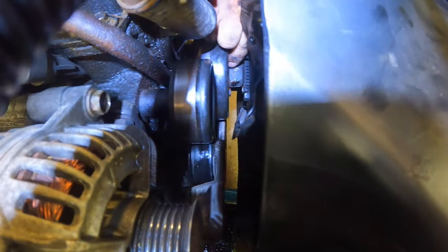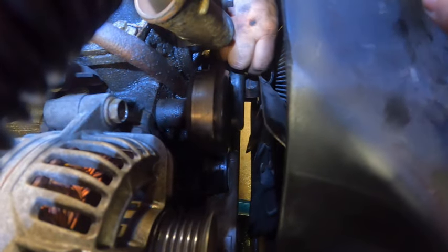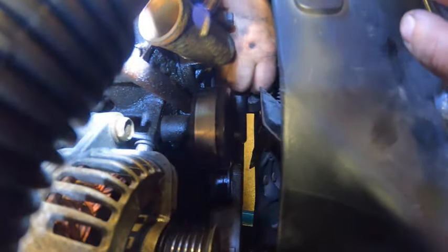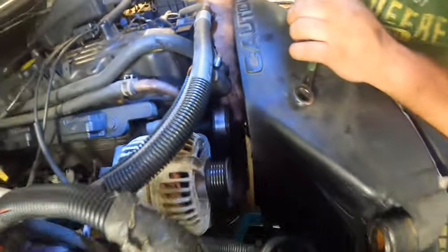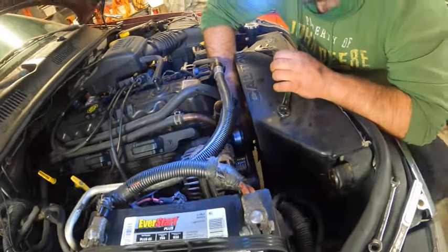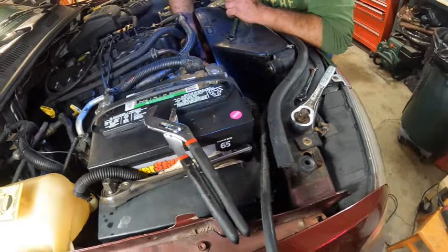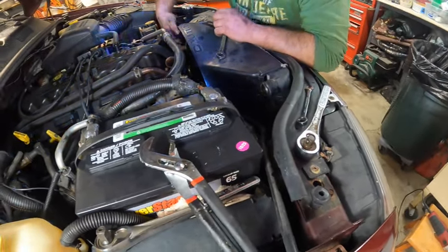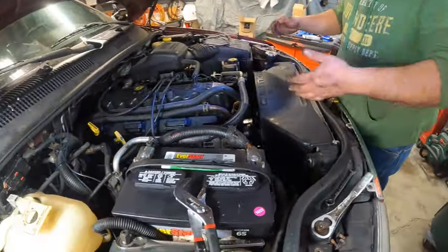We really struggled getting this fan clutch pulley assembly off of this car. And he's removing a small nut that holds the pulley on. Don't do that. We've already removed the belt. Don't do that. We've already loosened the fan shroud. Don't do that either. The first thing you have to do is get that big nut right below his finger, and that will allow that fan to unthread. The way you do that is you take a small needle nose vice grips, clamp it to the water pump pulley. I'll show you in a little bit where to clamp it. Then you take channel locks and break that big nut loose so the fan can unscrew. It's a standard right-hand thread, so it'll come off rather easily.